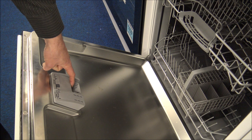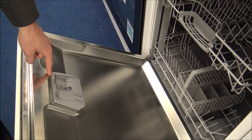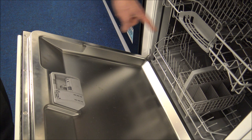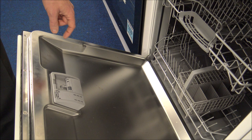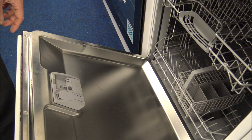In the middle here is where you put the tablets or gel pouches. You just press it closed and partway through the program it opens on its own. The beauty of this design — found on really all Siemens and Bosch dishwashers — is that when the tablet drops out it lands in a tray at the top, where it sits until dissolved. On many other brands, the tablet can drop into a cup or dish and won't dissolve properly, which can affect wash results. On the right-hand side is where you fill the rinse aid.